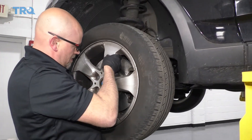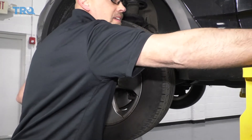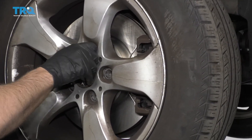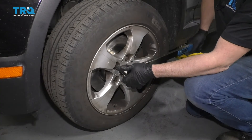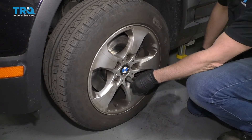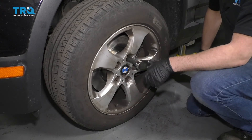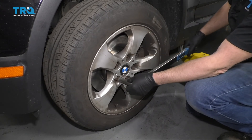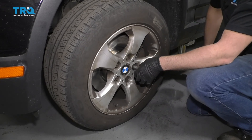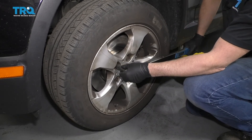Take the wheel, put the wheel back on, get the lug studs on, and I'm going to torque these lug bolts to 110 foot-pounds. I'm going to do it in a star pattern so that it tightens the wheel down evenly. Then just go around again to double-check.